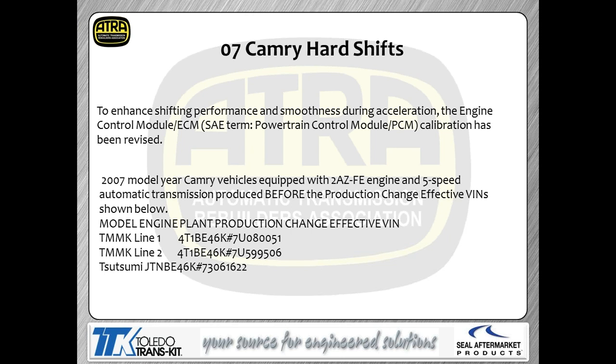So go through, make sure you're within the VIN breaks themselves, and if you are, physically do the update on the calibrations. Guys who are not doing calibrations are losing money. I'm just here to tell you, this stuff is not going to go away. You're going to see that even to change a solenoid on many transmissions, it's going to become a necessity that you recalibrate for that.